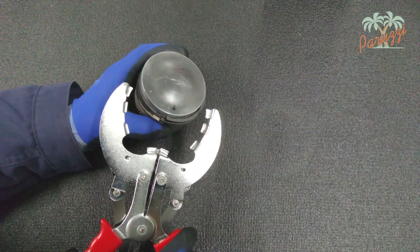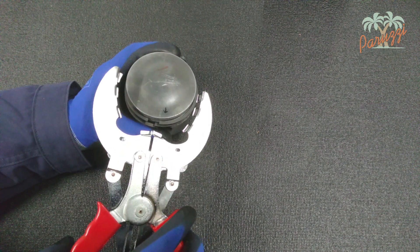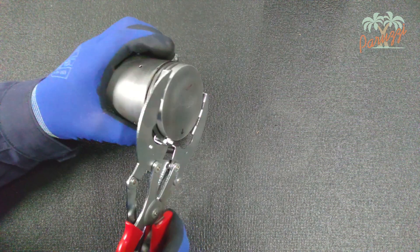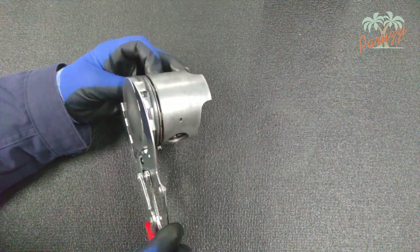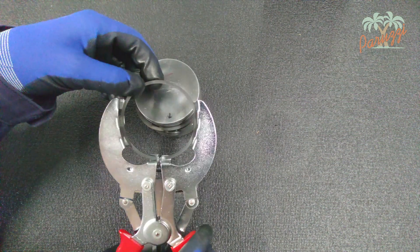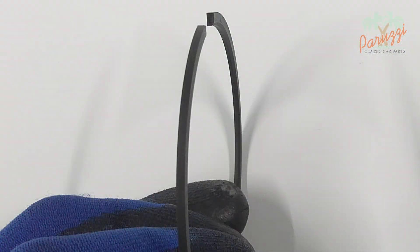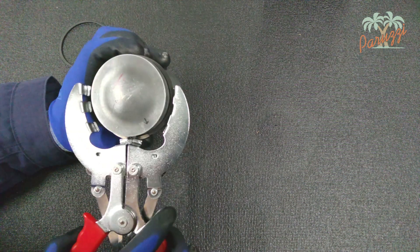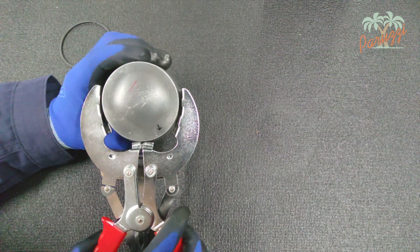Start with the upper compression ring. Take the time to position the gripper correctly to have an optimal grip on the compression ring. Check that the tool fits snugly all around the piston ring. Open the piston ring just enough to allow it to slide over the piston without touching the piston. If you plan to reuse the piston rings, keep them separate. Take a quick look at the shape and make a note of it to use later during assembly.